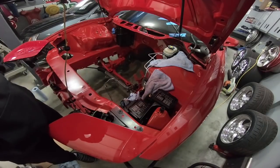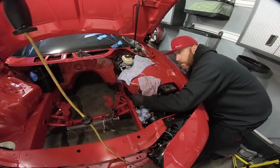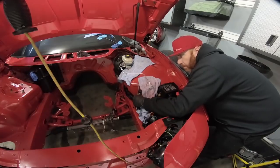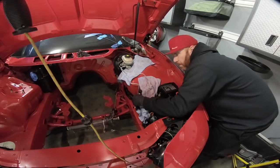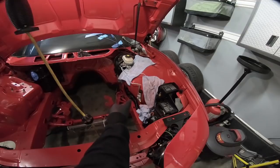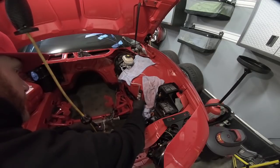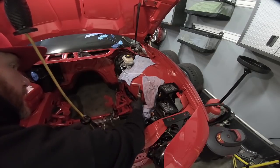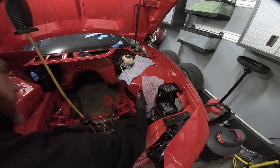Let's go ahead and mount this and then we'll work on this line. Now something to keep in mind when tightening those up is that it is just an aluminum housing, so don't get crazy. I also put a little piece of foam in between just so it's not bouncing around — the kit doesn't ask for that, but to me it seems like rattling around could loosen things up over time. So I just put a piece of felt behind it.